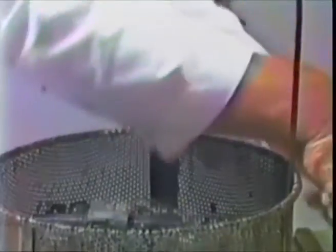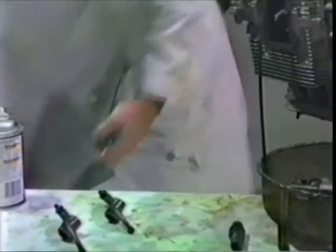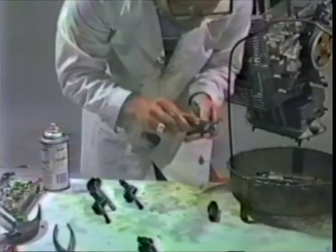So what we do is take the next best rocker. There's the next best rocker. Goes shim, spring, shim, secret sauce. See if this one goes on a little better. Tap, tap, tap, tap. Okay, we'll get out our special installer and our special tool necessary for doing installation. Tap it a few times. Once it gets beyond the point of distortion here, then it goes on very well and spins very nicely.